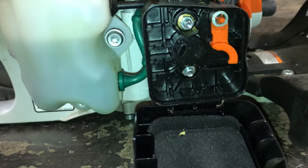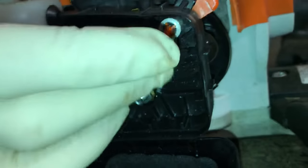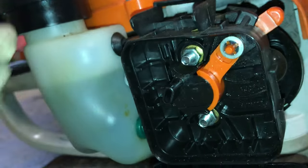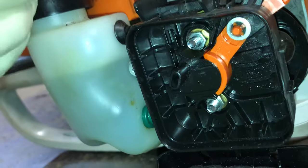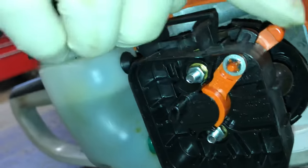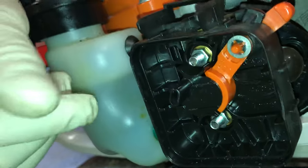I'm going to flip this choke on. When I flip the choke on, it literally puts a little bracket that actually closes off the throat of the carburetor — now the choke is on. So if you need to know when the choke is on, you can take your air filter out, push the knob one way or the other — that's off and that's on.